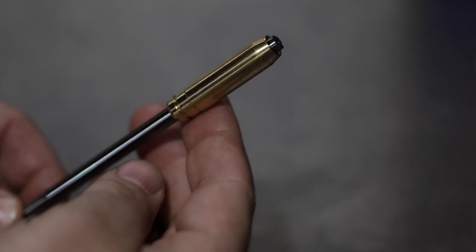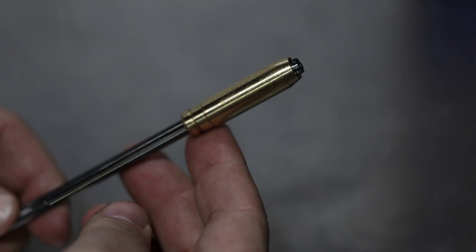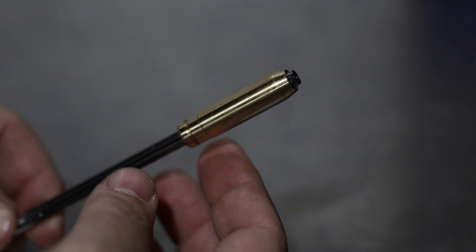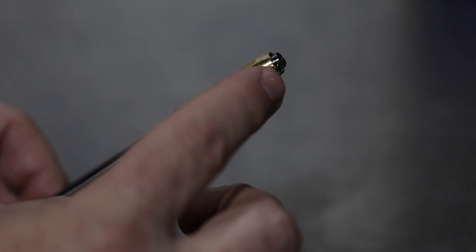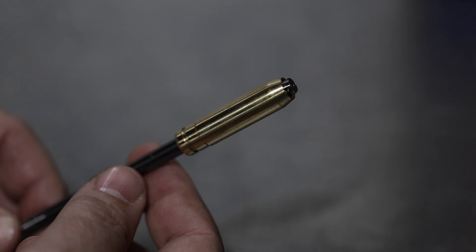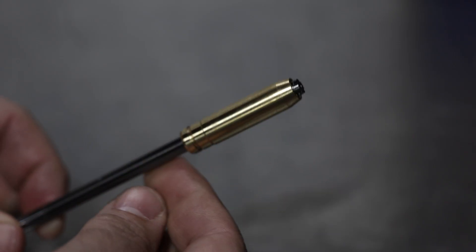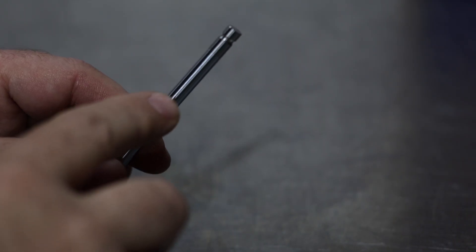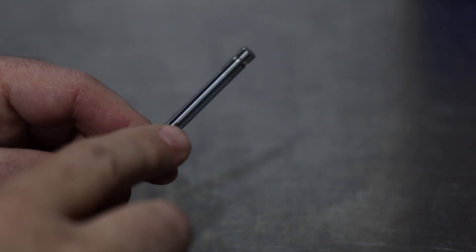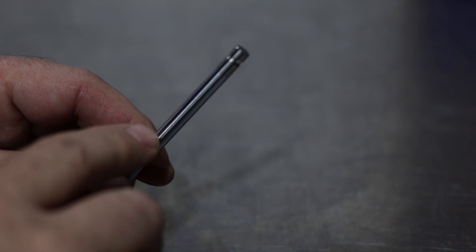Here's an illustration of a brand new valve guide on this reamer. Valve guides don't come sized from say GSE or Ferrea — you actually have to size them. Every valve has a different diameter in the stem. You can see how far the reamer goes through the guide before it actually starts cutting it, so it really is imperative that it centers the guide. These reamers all have to do with the size of the stem. The stem is not the same between OEM, Ferrea, GSE, or Supertech — all of them have a different size stem, so we have to use different size reamers.